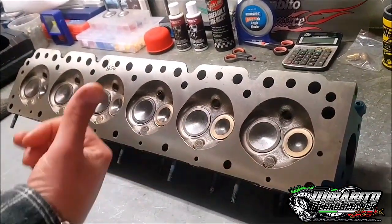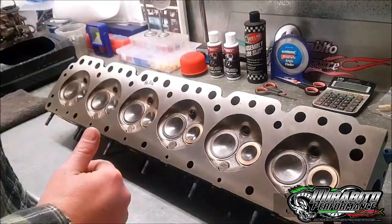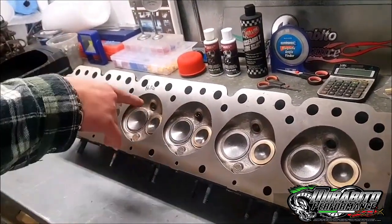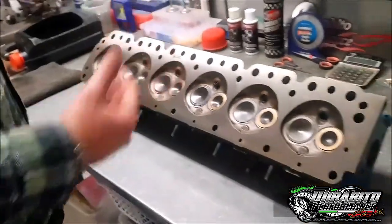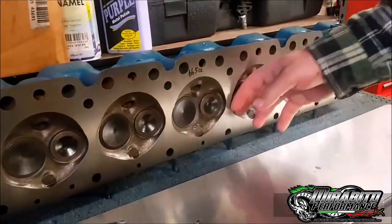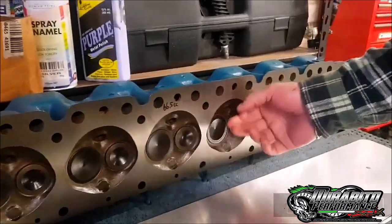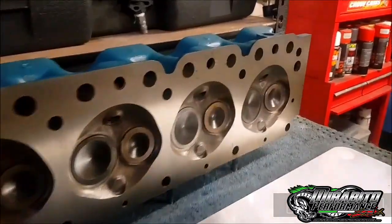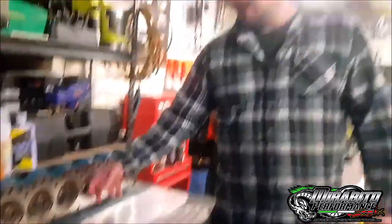Actually what I'll do now is take you inside and show you this little thing you can go on to get your compression ratio. We'll fucking do it to 66.5 and we'll pretend we put this head on a 265 or something. I'm just going to say - why I use coolant in the head is because that way it just doesn't try to rust or nothing. If you want to, you can use whatever you want to put in there. I just use coolant because it's easy. You can see it real mint and green and nothing's going to rust. Let's go do this compression ratio calculator and see where the bitch ends up.